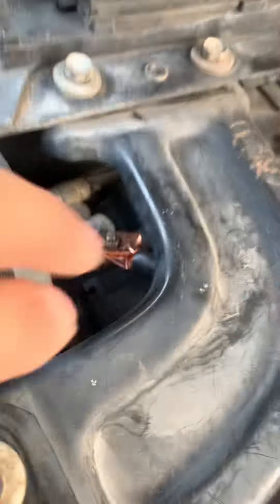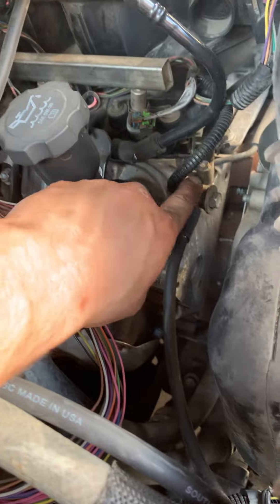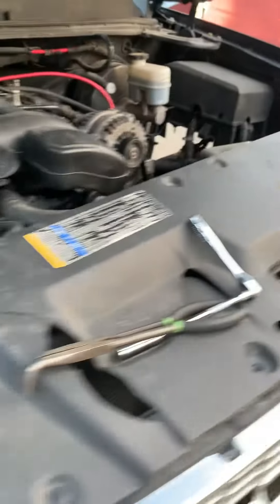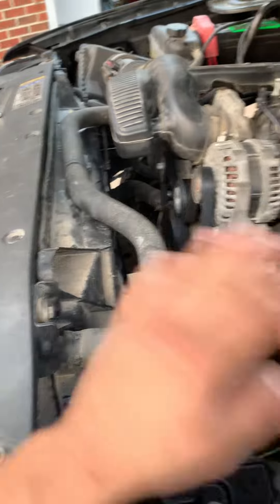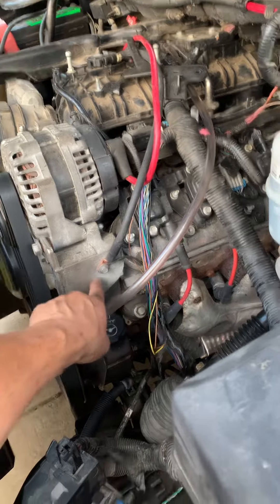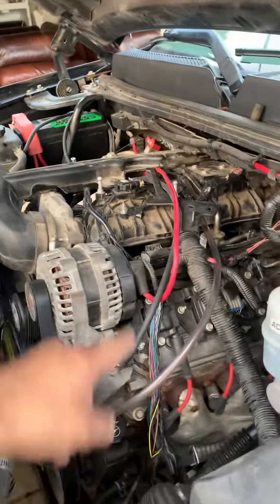I'll show you and then explain it. You can see closely — there are two ground wires, two cables that come out. One goes down here to the frame, and I put it right here on this ground point for the engine, on the front of the head, to the battery. So the engine is grounded on that point and on this point where the wire harness meets. I put the ground on the block — cleaned everything down — and then added here, running these wires all direct to the battery like a race car. So I put two major grounds on it.